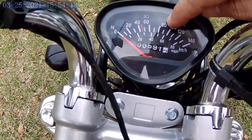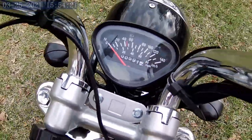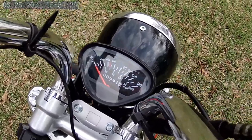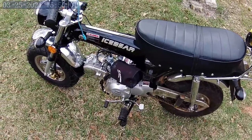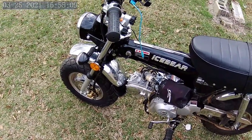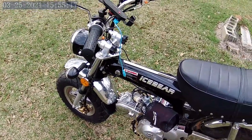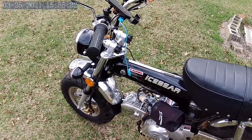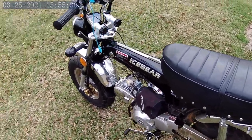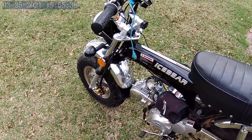With these tires on the bike, the speedometer reads pretty much the right speed — GPS indicated 50 mph is actually 80 km/h, which is close to 50 on the speedometer. The odometer does not count right though — it counts about 46% more miles than actual miles traveled. The bike will run 59 mph down a slight hill but gets some vibration and feels a bit unstable, so 49-50 mph is the sweet spot. It gets 62.75 miles per gallon riding constantly at 49-50 mph on the road. That's basically everything I've done to the bike — I hope this video is informative and you enjoy it.